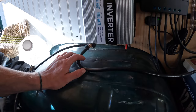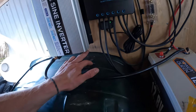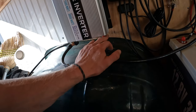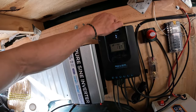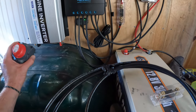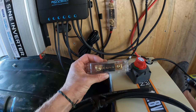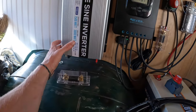We've taken the negative to the negative. Now time to mess with the positive — unfortunately this isn't really an ideal situation, so I'm going to have to wire it up, around, and then back down. To hook up the positive, we take from the battery through a switch, then through a fuse to the inverter, and then we're going to ground it as well.